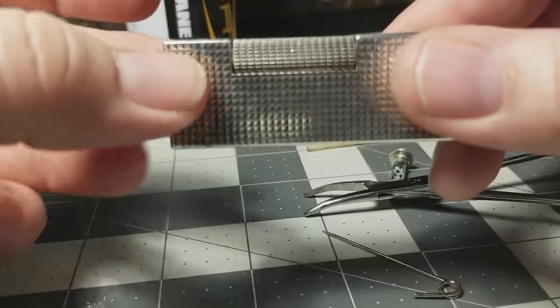That's all there is to fixing one of these — two o-rings, a little bit of grease, a little bit of patience and finagling. After you've filled it for the first time having been apart, there's still going to be a little bit of air inside the tank, so the flame is going to be a little jumpy — wanting to go higher and lower every time you open the lid. Just use it for a while until the tank has emptied and refilled and only butane remains, no air. If your lighter has a jumpy, inconsistent flame, just be patient with it and it'll go back to how it should be once the tank is purged of all air.